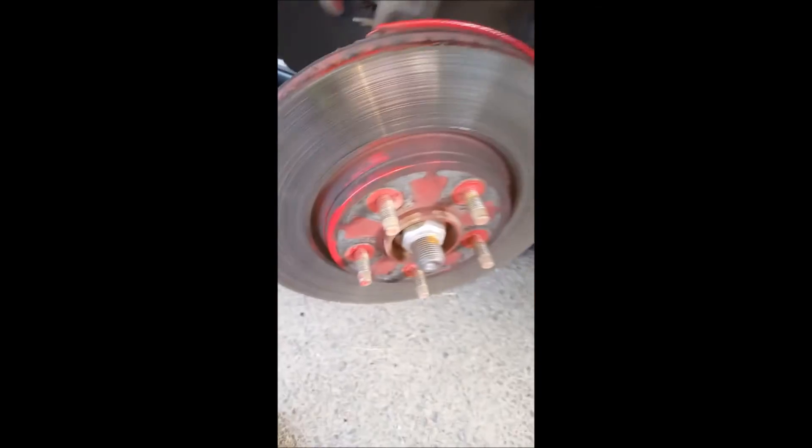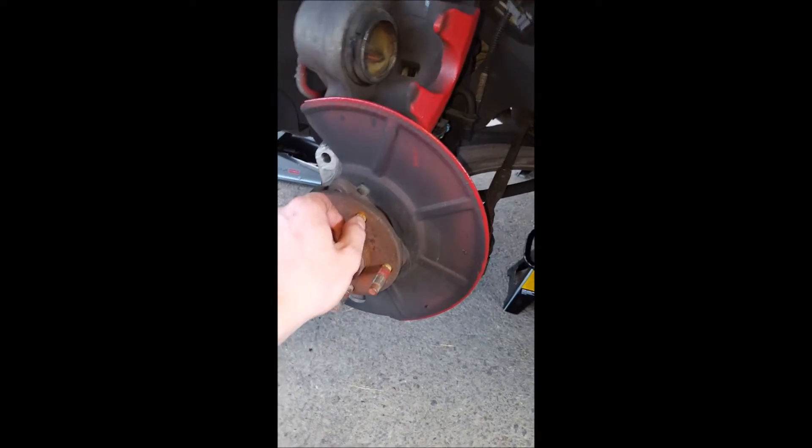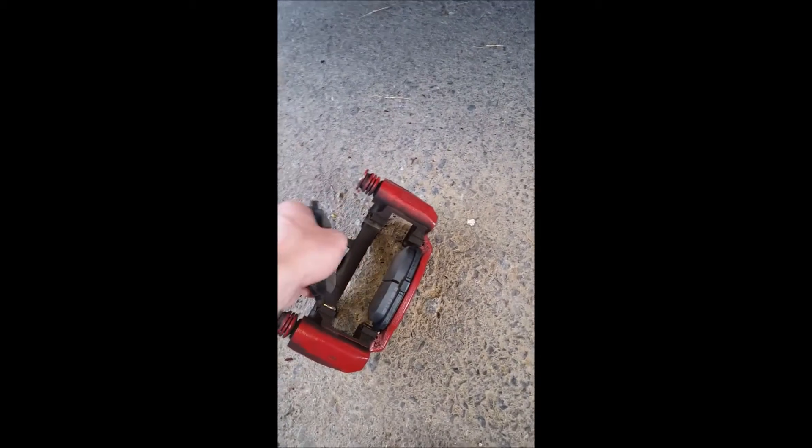After this you should be able to just pull off the rotor, replace the brake pads and put it back on. So I got the rotor off. There might be a couple of pins that go over the bolts that actually hold your rotor on — just pull them off with a pair of pliers. Then the brake pads are easy, you just slide them right into these brackets.